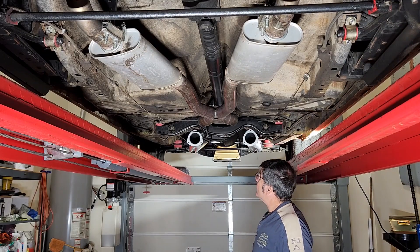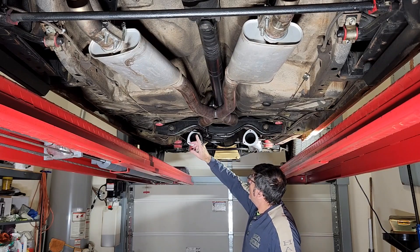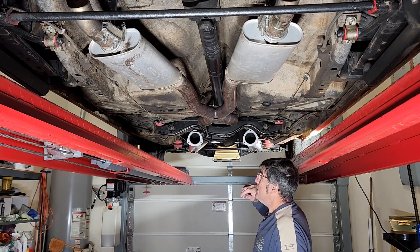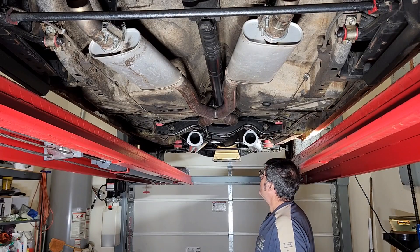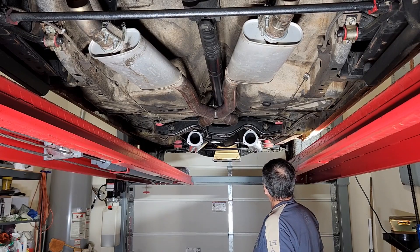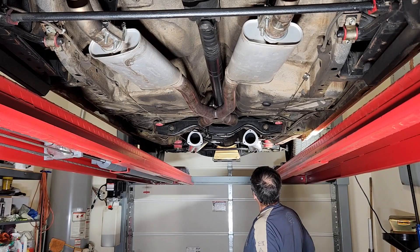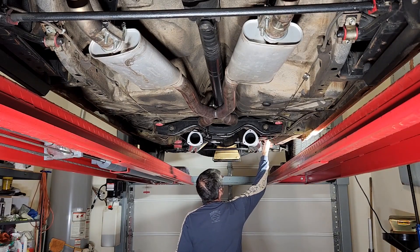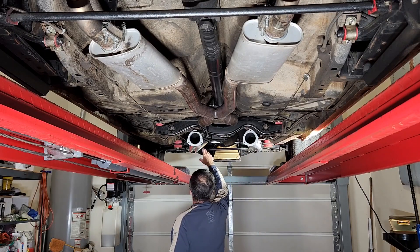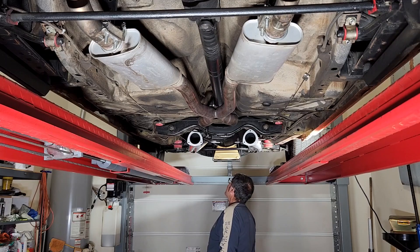These TTIs, as you can see, the fit — they line up very well with the crossmember. The pipes will come in without really too many bends in them, just probably 145. The fitment going up is really good. This header tube required a little clearancing up in here around the torsion bar and right up there at the trans, and this one just a little bit right up at the steering box.